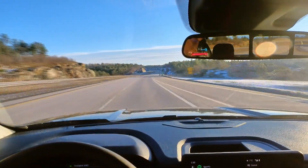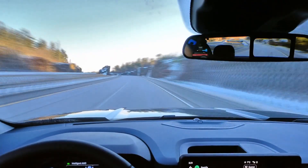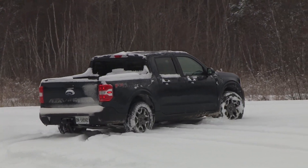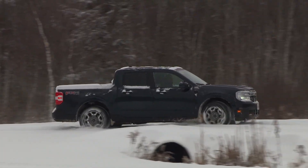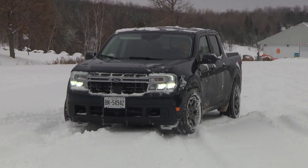While you're cruising down the highway on a sunny Sunday afternoon and traction is abundant, the all-wheel drive is decoupled, its gears and shafts stop spinning, and you're running in a fuel-saving front-wheel drive setup. When slippery surfaces cause traction to run low, or when the Maverick's all-wheel drive computer predicts they might be about to, the PTU is reconnected. It can switch from fully disconnected to fully operational in a few hundred milliseconds — re-engaging all-wheel drive traction in roughly the time it takes a human being to blink.